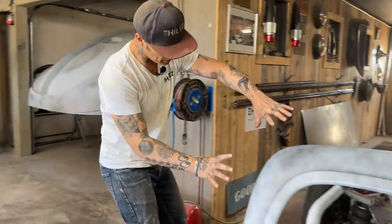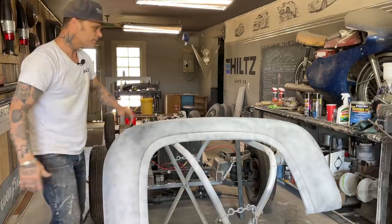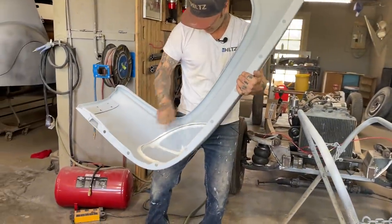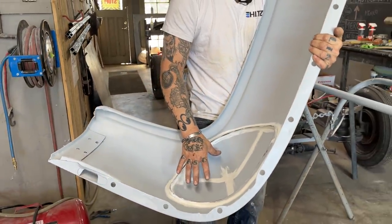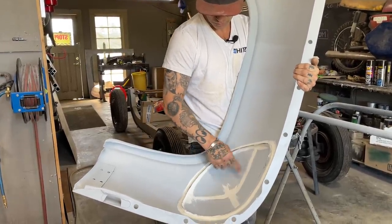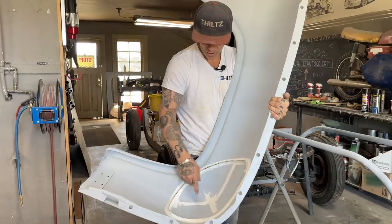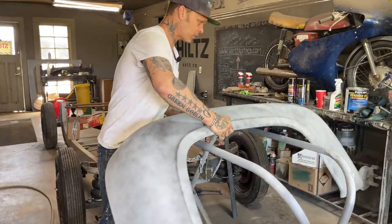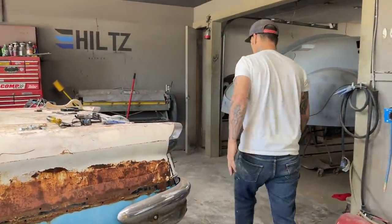With the repair, we put this piece in here. If you don't remember or seen this video, we made the piece that fits here where the tire used to be. When I cut it out, I left the half inch that was all the way around there that butt welded to. The reason I left it is because it kept structure to the fender when I was putting my piece on. As this is where I put the piece on, I just seam sealed where I butt welded together and seam sealed where it was welded around the edge. And that's basically it. This was a fender that did not get the piece, it got the patch. Just like that. It gave up smoking and got the patch. So that's how I'm gonna give that back to the man that owns that. I'm happy to have that done. And I hope it satisfies him, and I'm sure it will.